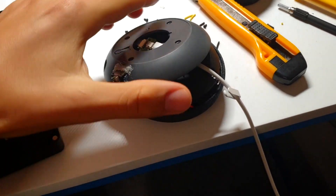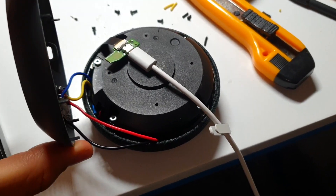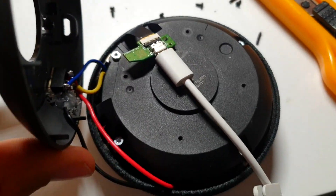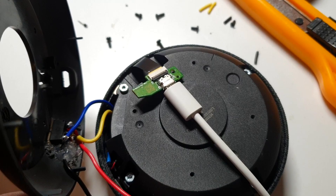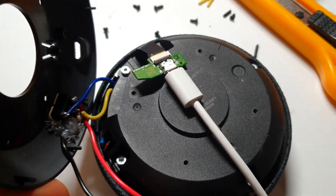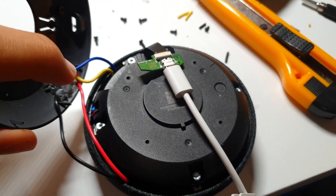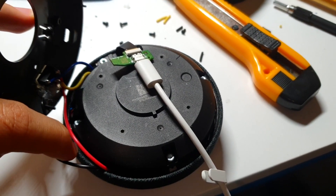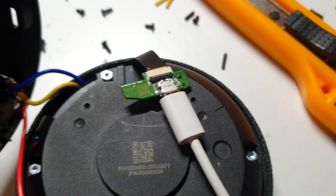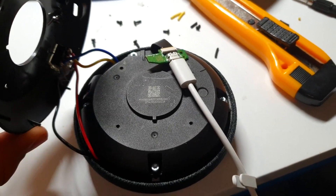So as you can see, the Google Home Mini is all in one piece. All the wires are connected and currently it's playing music from the built-in speaker. I've also cut the power PCB to make room for the audio jack, which means I no longer have a mute switch — I really don't mind, as if I want to mute it I'll just unplug it from the wall. The last steps are to bolt this together. The trick is to first put this in, then shove the wires in between the gap of the speaker and the shell, and once that's in you can put the top on. Don't forget to screw in the power PCB to the appropriate hole.